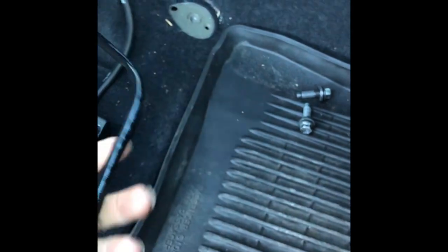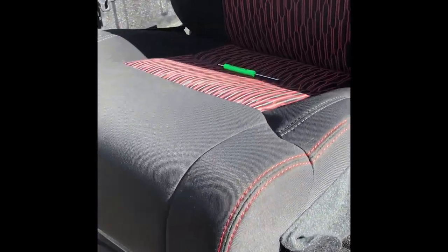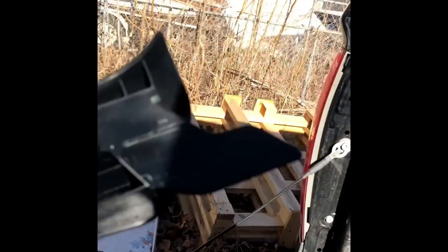You have one harness clip right here — I've actually broken mine, so just be very careful when you pull that out, but it still connects. This is the harness for the seat heaters and it runs underneath the center console. You want to run it out about a foot and a half to two feet, and that'll give you enough room to get to the connectors for the seat heaters in the rear and not stress any wires when the seat's all the way back.